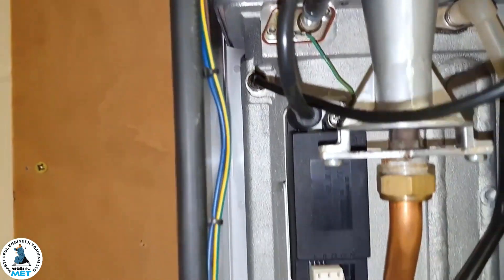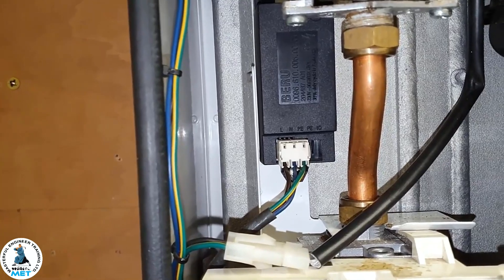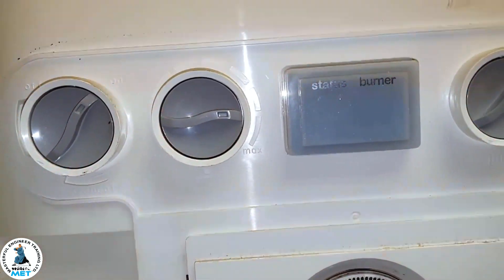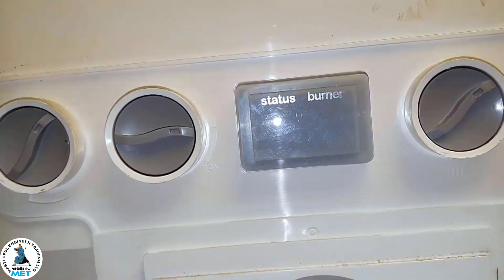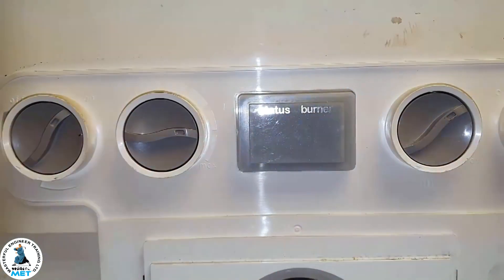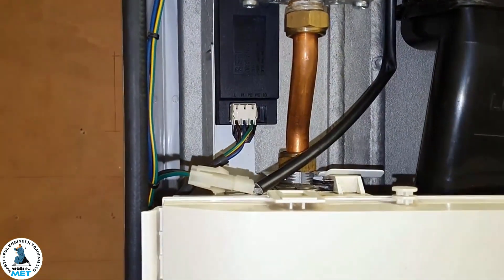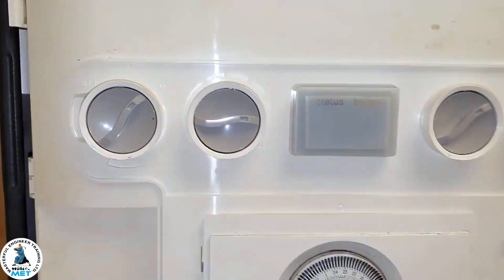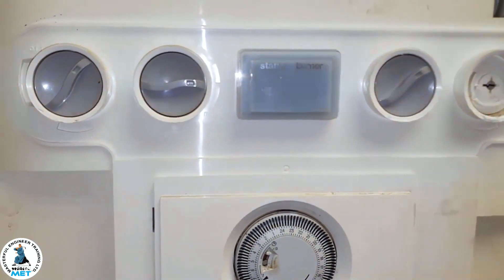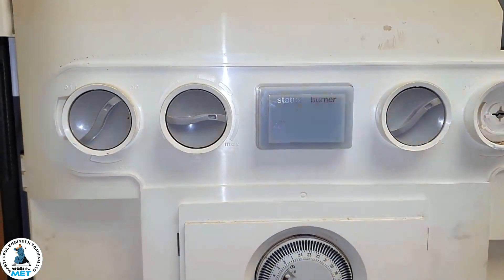So there are two branches: the spark electrode not sparking to light the flame, the spark generator not sparking, or the gas valve not opening — in those cases you're not going to get the blue light at all. But where the blue light comes on and then goes off, you know the gas valve, spark generator, and all of that has worked. So the blue light is a good tip — blue light means the gas valve has opened and the spark generator is working.